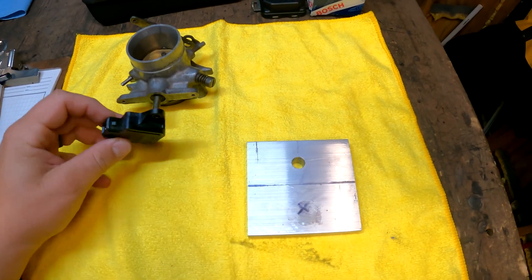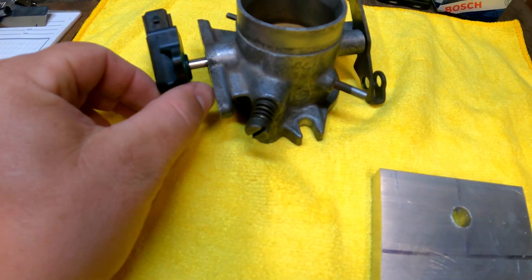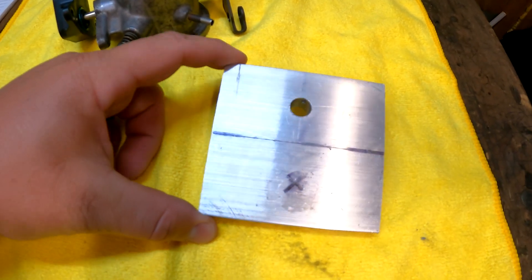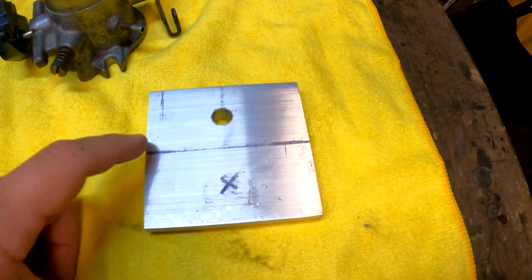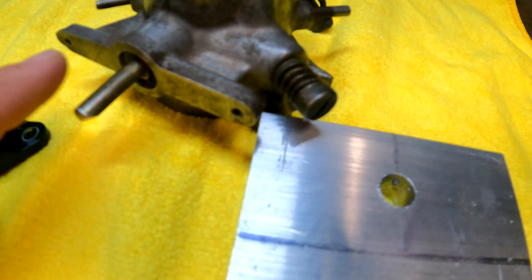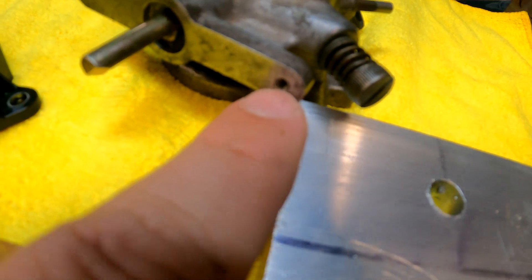Here's what we've got. I've got my TPS — we put this in here and it's just shy of half an inch. So I got a three-and-a-half-inch wide piece of half-inch bar stock, cut to three and a half inches wide. The goal is to get the center bore large enough to go over the D-shaft — which it already is — and get it attached with a couple of drilled holes. This is already tapped for M4, so we'll just drill a hole through here.